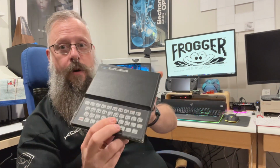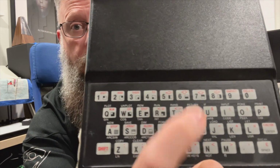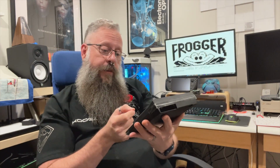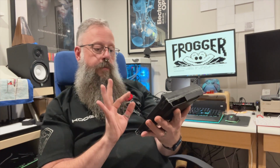But there was one problem with this computer that unfortunately I caused. I dropped something on the keyboard, and if you look very carefully, the Y key is damaged, and it's actually more damaged, I think, now, as I look at it. So that Y key is pretty damaged, unfortunately. Now, I also figured out how to fix it a little bit because I just stuck a little knife in there and popped it up. Because again, membrane keyboards work very much on touch, and so the connection piece obviously was sorted a little bit by that.